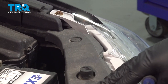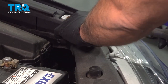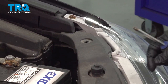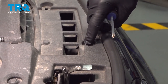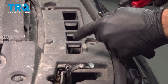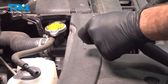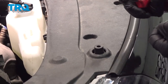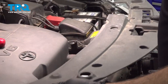I'm going to open up your hood and start by removing our upper cover. I'm going to use our Phillips head screwdriver, pop out that center, and then pop out the plastic clip. If it doesn't have the Phillips head screw, you can usually press in on the center — you can hear that pop in. Use your trim tool and pop that button out. Repeat that process through the rest of these clips. Once you have all those clips out, just lift up on this cover and set it aside.